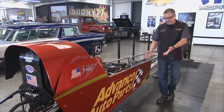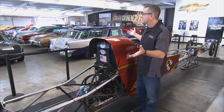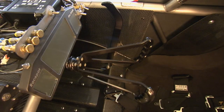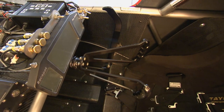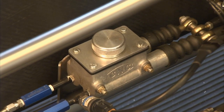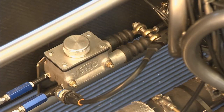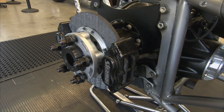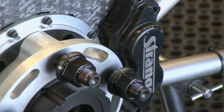Welcome back — I'm excited to introduce a new segment called the Performance Playbook, here at Bernie's Speed Shop where they build some of the baddest rides on the planet, including this fuel dragster owned by Josh Hart. Josh, we've been talking about brakes today — we did a master cylinder and upgraded some brakes — but nothing to this level. How do you stop this thing at 285 miles an hour? I throw the parachutes, grab the hand brake — it applies pressure through the master cylinder to a set of carbon fiber brakes: four calipers, four-piston each, with carbon fiber rotors and carbon fiber pads.